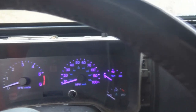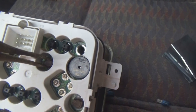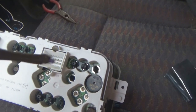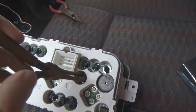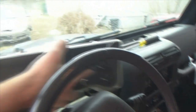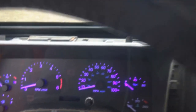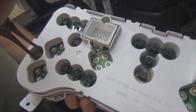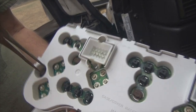We've got purple here, here, here — three lit up on this end — but this end right here we've got to change these around. Again, like I said, the polarity is sensitive and it's a trial and error thing. But luckily the TJs are a heck of a lot easier than the YJs. Instead of pulling the bulb completely out of the socket, grab your pliers, rotate the whole bulb 180 degrees, drop it back in the socket, twist and lock it back in. That way you don't risk breaking the LED pulling it out of the socket. Slide her back in, lock it, engage the contacts. There it is. Pretty easy — I wish the YJs were this simple.